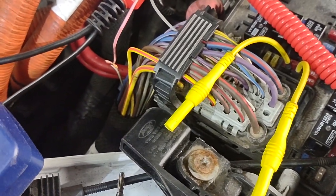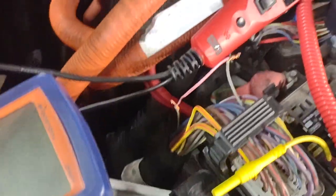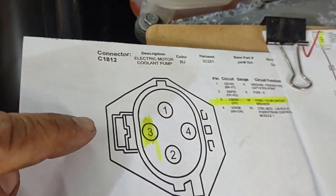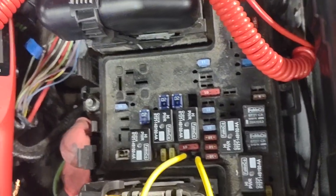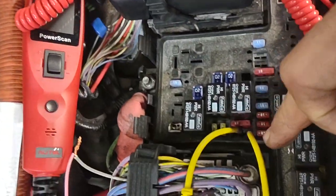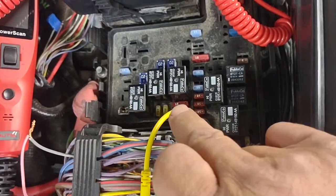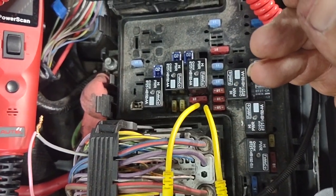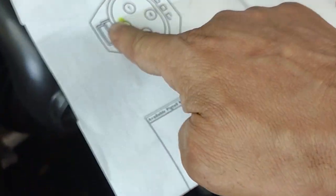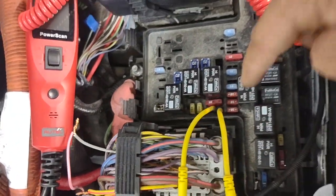To make a long story short, I did check the power going to the module. This is the pump connector. The issue is with pin number three. I noticed someone was working on this car before. I found that there is a fuse — fuse 12 — right here in this area. This is the fuse that feeds power to number three. This is the number three bronze terminal, and the fuse 12 feeds the number three on the harness on the pump.